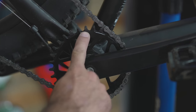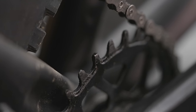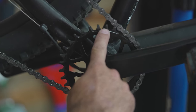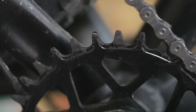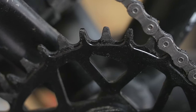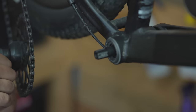I think it's the front chain ring. On a good bike with a one-by drivetrain, you have a single-speed chain ring with alternating teeth — one is narrow and one is wide, just like a chain. This way, it provides the most contact with the chain possible and helps it stay in place. The chain ring that it came with is sort of like that, but not really. To further complicate matters, you can't change out this chain ring.